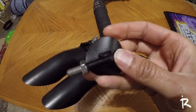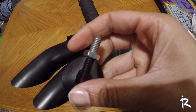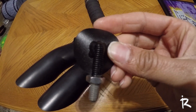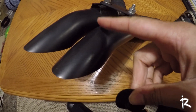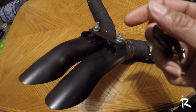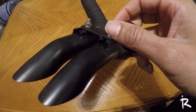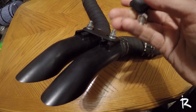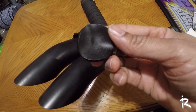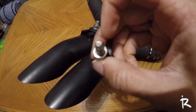You get two of these and they cost roughly forty dollars from DK Customs, a little bit less with shipping included. These are going to mount inside the exhaust because these exhausts are very short and they do not have baffles — it reduces the amount of back pressure that the Sportster originally had. So these are going to add that back pressure back in.